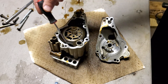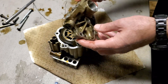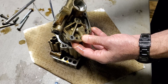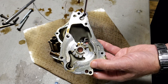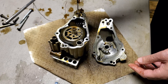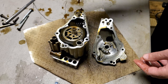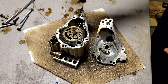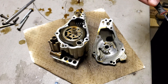The other way that this area can be pressurized is directly from the oil pressure itself. There's a cavity which comes directly from the main oil rail into this hole here, then across this tube, down through there, across this cavity, and then in through the piston. This piston spring has quite a lot of pressure on it, so by default the spring will be extended and oil will not be able to flow. But when oil pressure gets really high, this spring will push all the way down and oil will go past the piston into this hole, across the back, and into the cavity here — also pivoting down and reducing the flow rate.